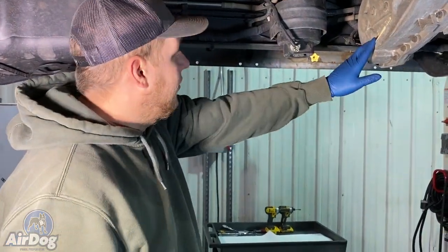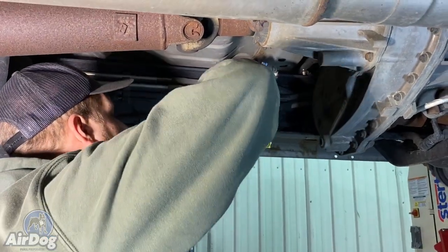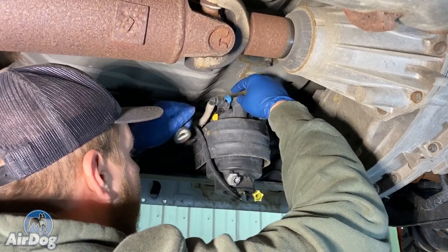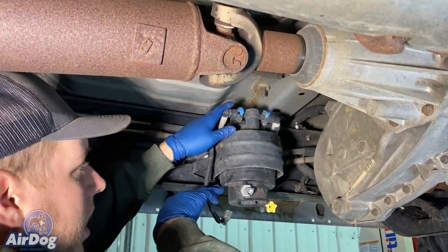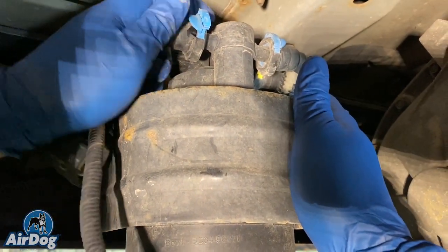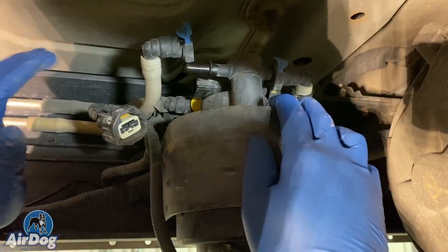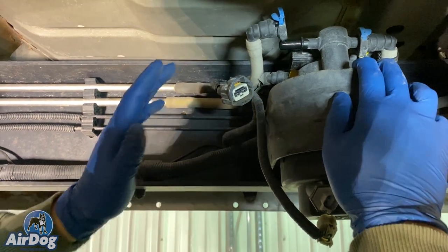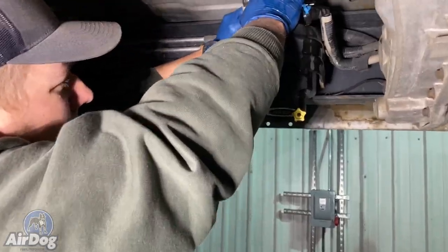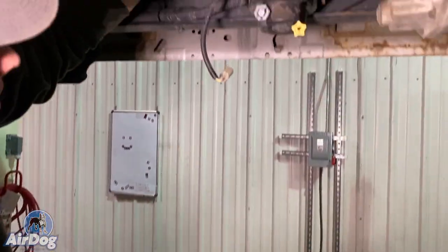Your factory lift pump is going to be in between your tank and your transfer case. First things first, we're going to have to remove all the electrical connectors from this as well as the fuel line connections. We'll start by getting the electrical connections off. You'll need to grab a screwdriver and pop that off. To remove the actual fuel line connections, there's going to be a lock on these — pull that lock up, press the fitting in to relieve the stress off of it, push that tab in, and pull out. Do that on all line connections. Just be careful because there is going to be some fuel retaining in this, so have a bucket ready as well as some hazmat pads to keep your mess clean.